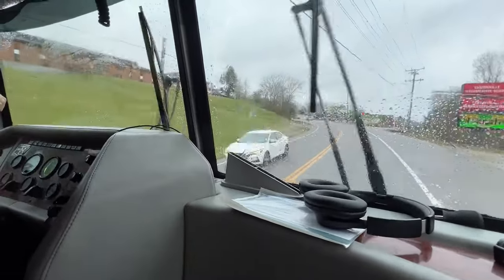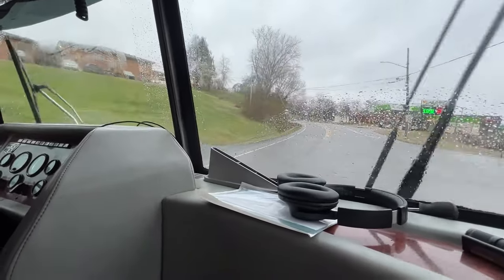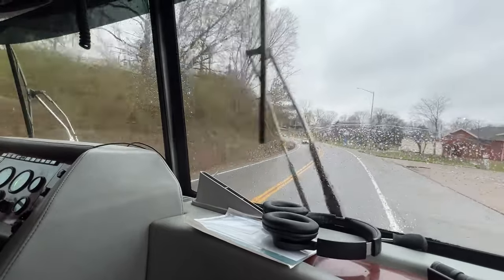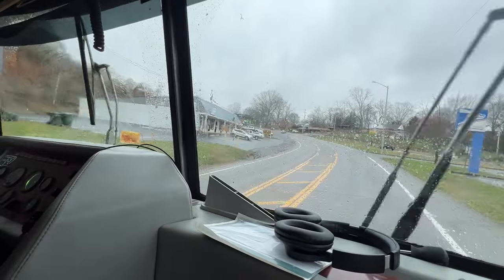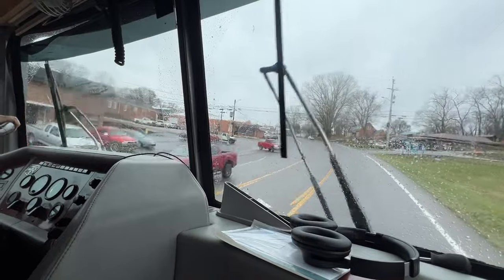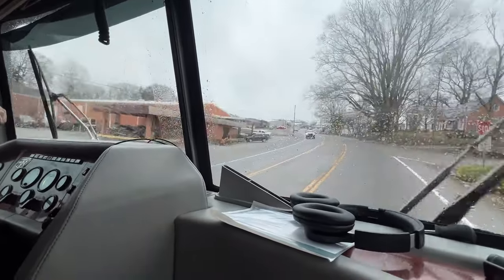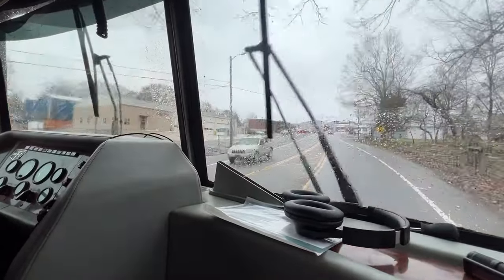Should feel like it's got plenty of power and everything too with the tune up. Does it feel any peppier or no? It does actually. Yeah. It revs faster, that's for sure. Your fuel injector timing was set slightly retarded. Only a few of your exhaust valves were off, but all your injectors were.